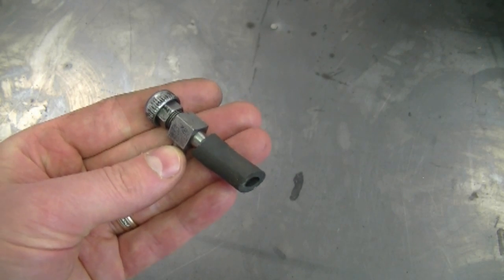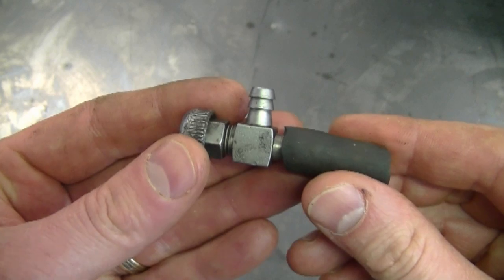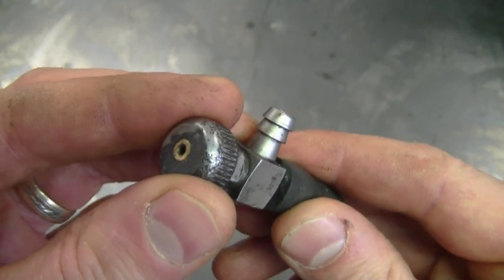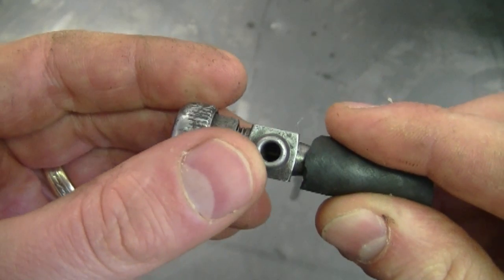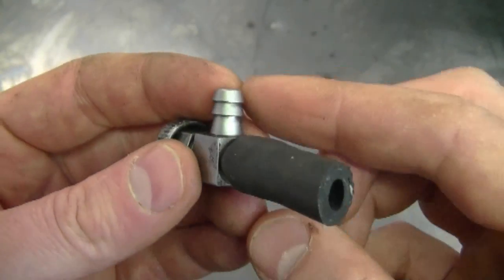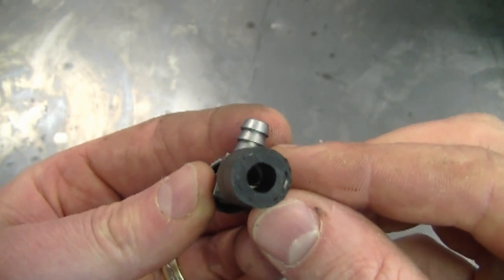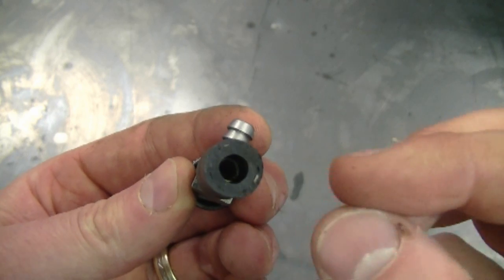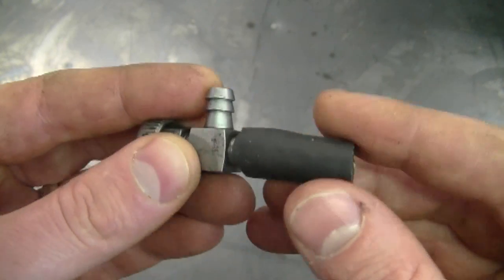Now, I haven't seen his snowblower physically, but what I find that usually happens on these older snowblowers is that they have a fuel valve like this, which is made of metal, and oftentimes it gets so rusted inside there that it's plugged. And at that point, the fuel cannot flow in and out to go to the carburetor. If it does flow, it may be very limited. There could also be a lot of rust going into your carburetor and causing a problem.